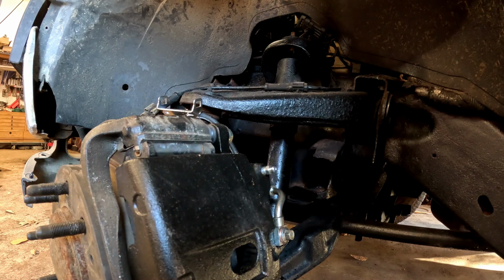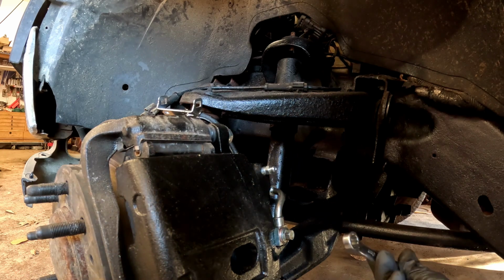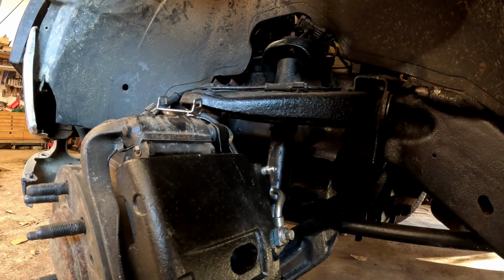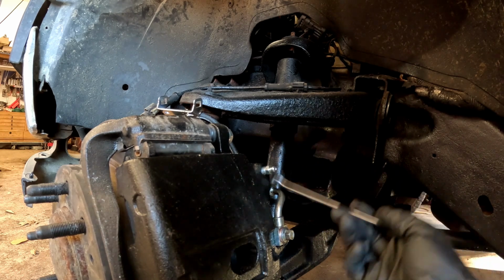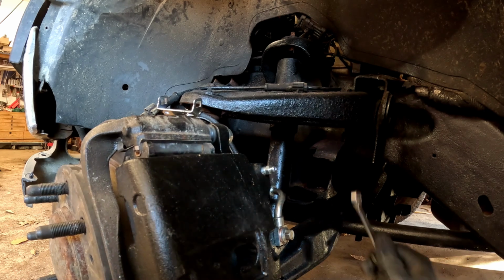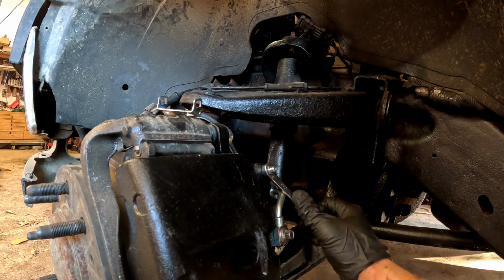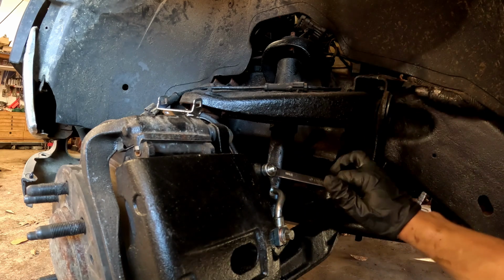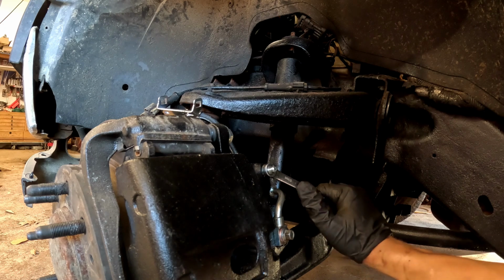Okay guys, now we're going to bleed the brakes. I got Dad in the truck to help me, and he's gonna pump the brakes, and this is your bleeder right here. So once he pumps it up a little bit, I'm gonna crack the bleeder, and you wanna keep bleeding it until you don't hear any air and the fluid starts to come out. It's pretty easy. How's it now? Good? Okay. All right, fluid's coming right out, so that's good. That means it's in the caliper.